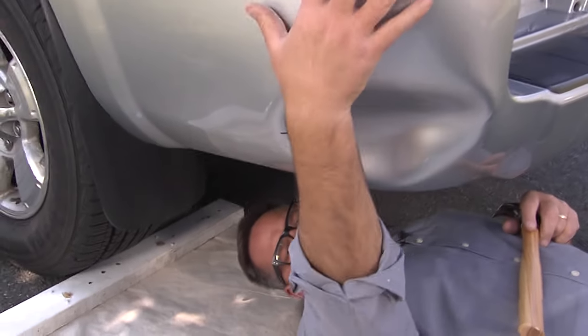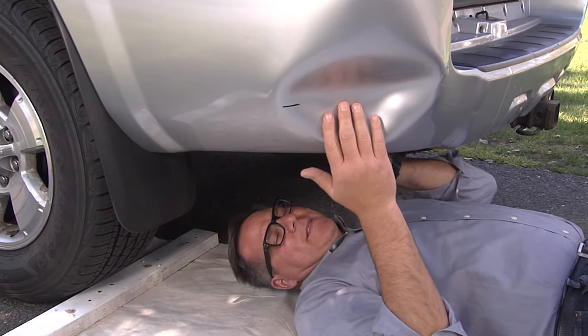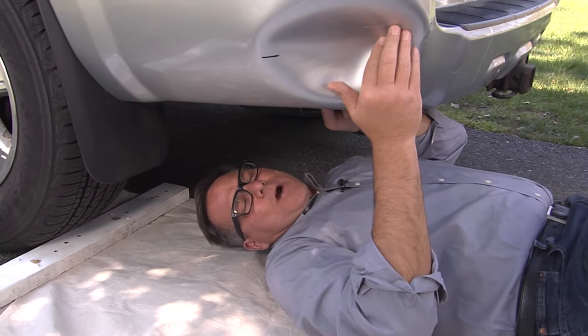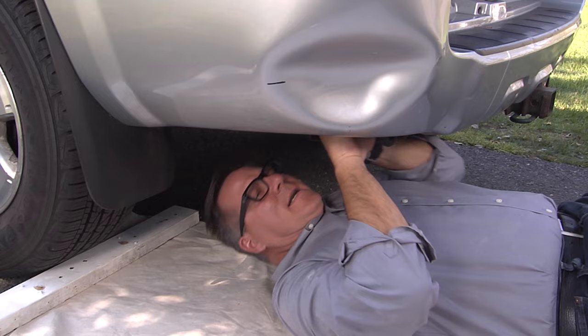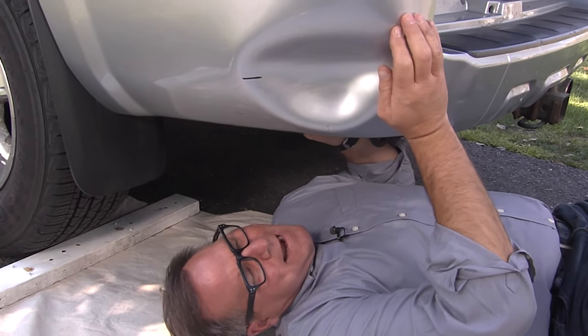In this particular car, you see this molded bumper comes down, and I can actually get behind it with the handle of this hammer or a short stick. The key is you don't just want to push it — you want to try and roll it out. So you're going to try and find a spot where you can kind of get into it and really work that plastic.